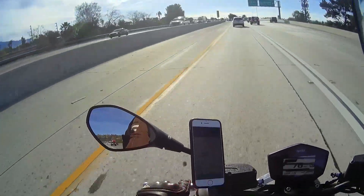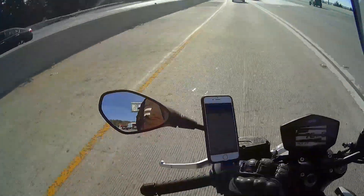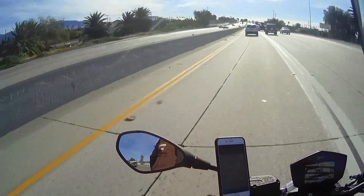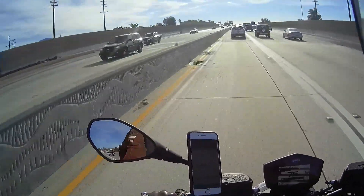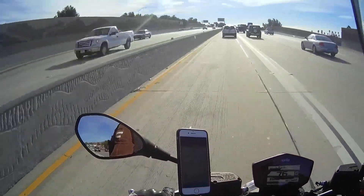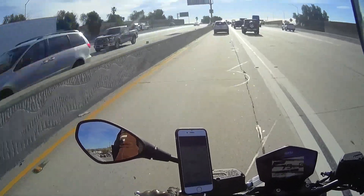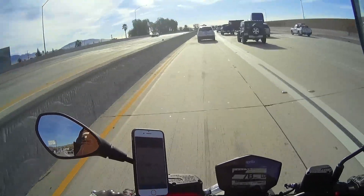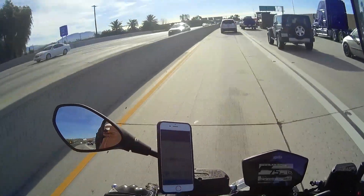While I'm not so happy with the suspension on the freeway, the bike feels 100% stable even at high speed. It has a somewhat relaxed wheelbase of 57.7 inches and rake just under 26 degrees, so it's not steep — there's really nothing nervous about the front end. Even though I may get bumped around a bit, the bike is still stable and predictable; I just may get a rougher ride than I like.